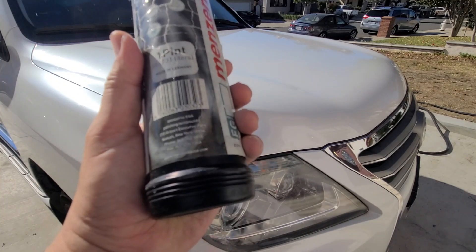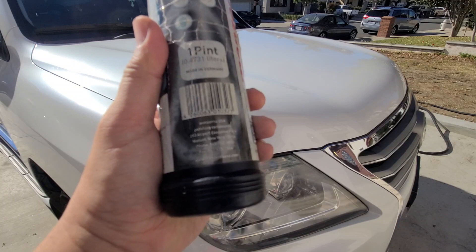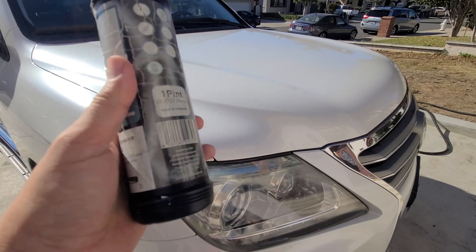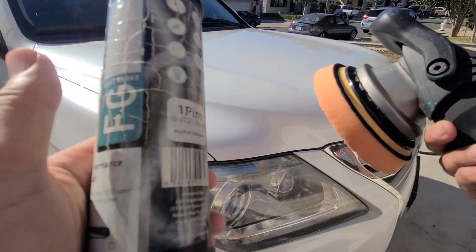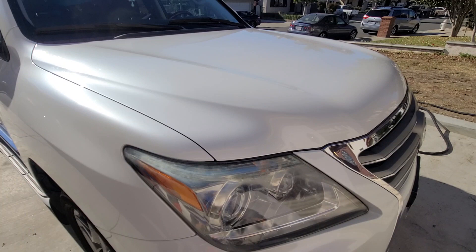Generally you want to wear gloves, so I'm going to put some on in a second. Another thing is you want a bottle of IPA mix — that's isopropyl alcohol mix, a 50/50 mix of water and alcohol. That way you can spray your pad to get it ready and also clean the surfaces of the paint so you know whether you've made progress or not.